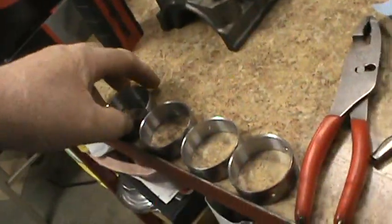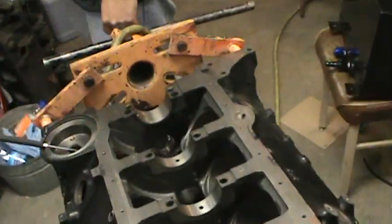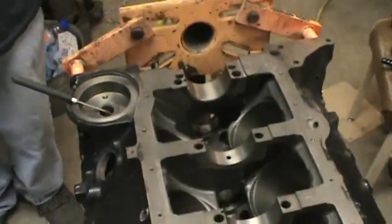I lay them out in order, keep them in order, and verify as you go — that's what you do. I've torn down enough motors and seen that the motors coming in where the holes are lined up with the mains always seem to have lower oil pressures than the ones I put together. Anyway, thanks for watching — this is just my take on cam bearing installation. See y'all later.